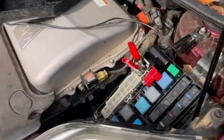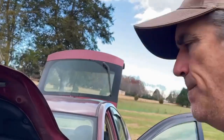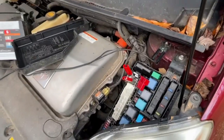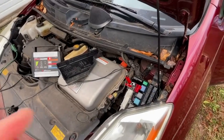This is just a quick tip of what I found to work for me. I don't know if it'll work for anybody else, but keeping that 12-volt battery in the back charged by going through with a charger and hooking up to it once every couple weeks seems to have fixed and helped my problem. This is the last piece of the puzzle, as far as what I know to do preventatively to keep those lights and codes from coming on — keep that 12-volt battery charged.